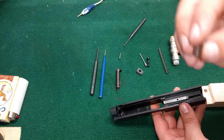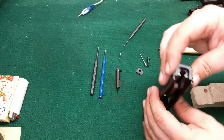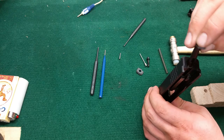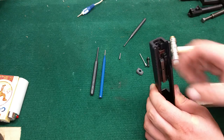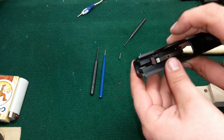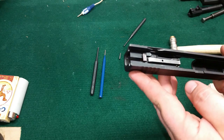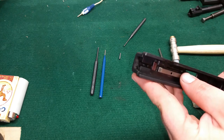Now putting it back together: you're going to want to take your spring and let it slide down in there. If you need to, give it a couple taps, make sure it goes all the way — seats all the way in there. Take your firing pin, line all that up. You want to make sure that this top piece slides right in there. I like to detent this and push my firing pin forward. Some springs are under more tension and actually keep pushing this off, but since this gun's been pretty beat, that thing is starting to loosen up a little bit.